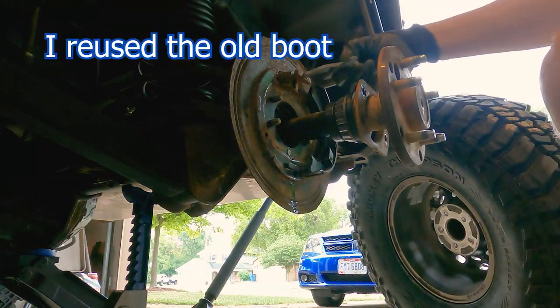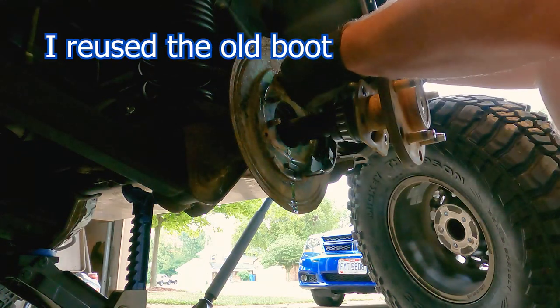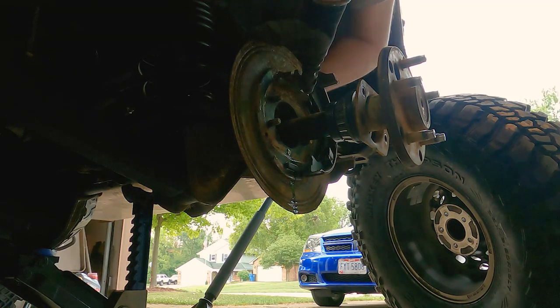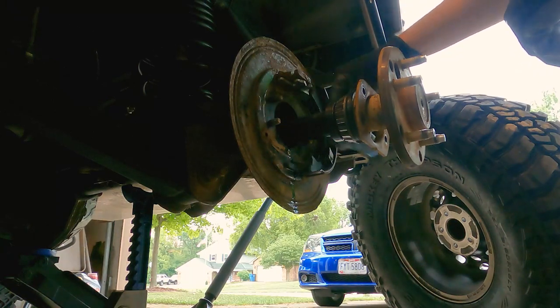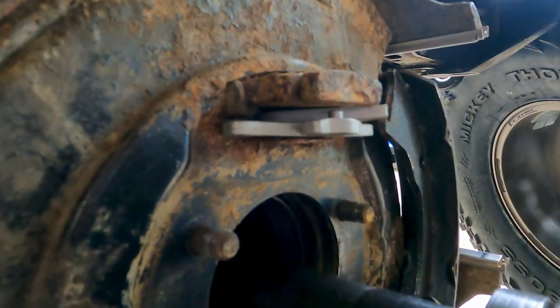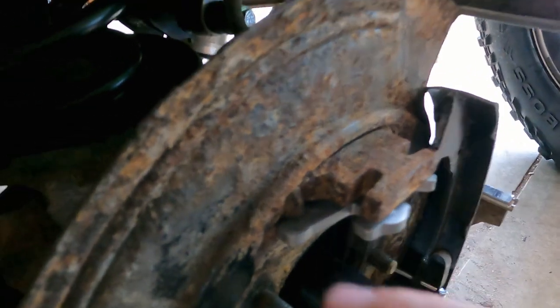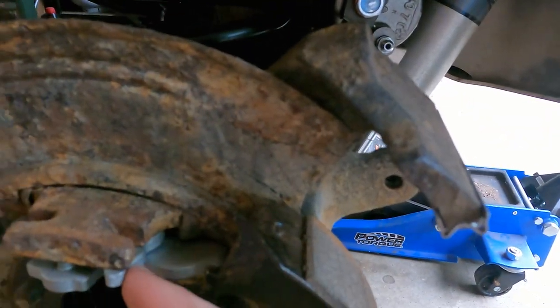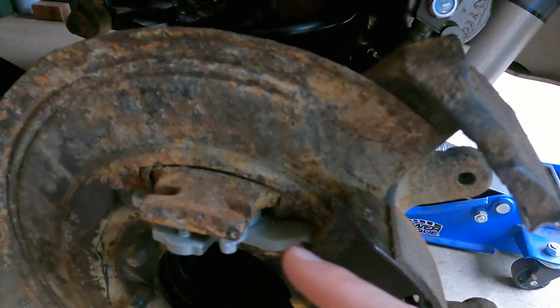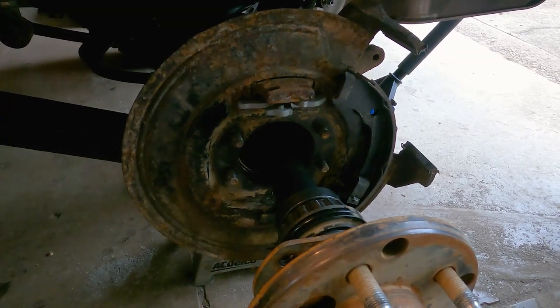Now time to stick it through that boot. It just kind of sits up there like that. One brake shoe will line up over here with this piece, and then this brake shoe will line up here with this piece. And then when you pull that cable, it'll kind of expand everything. When you release it, the spring tension of the brake shoe will push it in. Back here you can see it came through that rubber boot and it's sticking out — and then this cable will hook on there. Now I'm just going to quickly give you a time lapse of me putting the brake shoes back together.